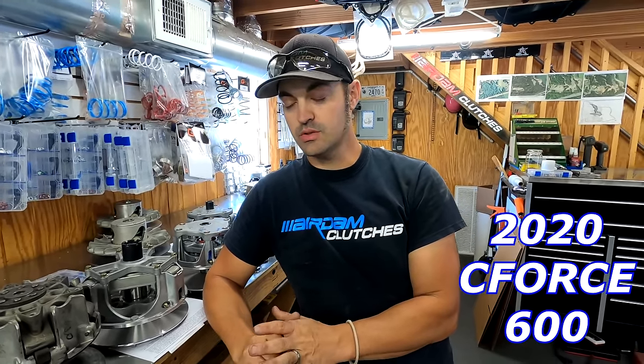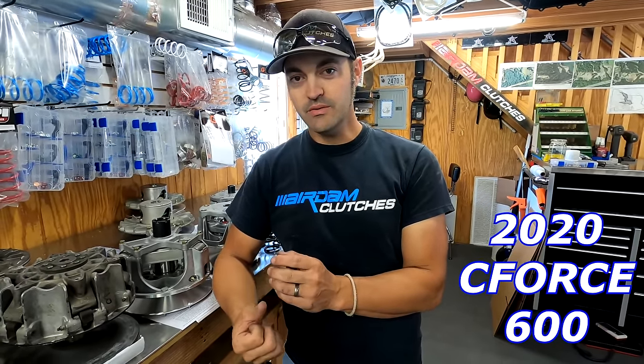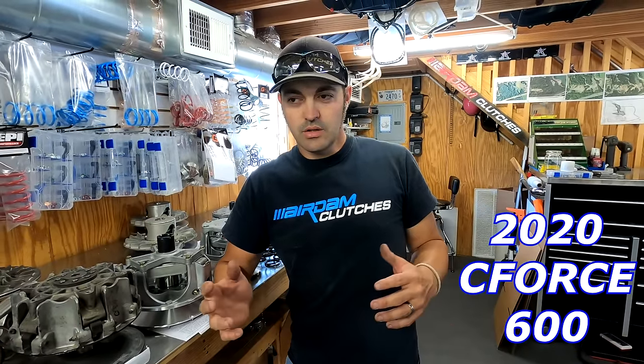So the 600, although it's a great looking machine, and it has decent power, the first thing I noticed when I got on it, and probably a lot of folks will notice, was the lack of direct drive from your throttle to what the tires are doing. And that's one of the things that the CVTs are really good at and capable of. You can give it throttle, you hear the motor rev up, you feel acceleration. The CVTs are really nice in that when they're tuned properly, they work pretty flawlessly. They're really efficient. Well, this thing, for some reason, when I got on it, you give it throttle and you hear the motor rev up, and you're giving it more throttle, but you're not getting the miles per hour and rate of acceleration behind it. Clearly, the clutch is kind of mushy, is probably the best way I can describe it. Your throttle response doesn't exactly equate to rate of acceleration.